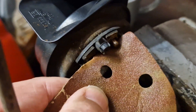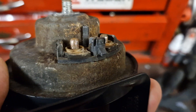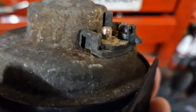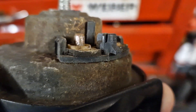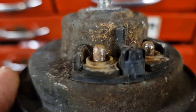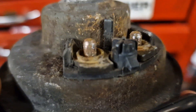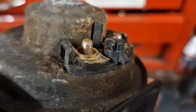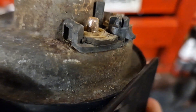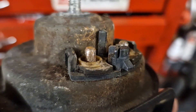I think a bit of sandpaper might do a better job than the file. We're getting there now - I've got quite a lot of nice brass showing again. I think before I go any further I'm going to put some power onto this and see if it's working, because it could actually be the horn itself that's failed. I'm hoping not, but you never know. That should be clean enough to do a test with a direct feed from the battery.